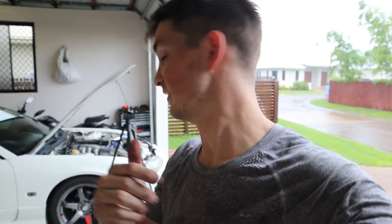When I took off that bleed valve, coolant kept coming out at a pretty fast rate with the screw all the way out - so it definitely bled the system but I was continually losing coolant. I let it pump out, refilled it, then put the screw back in and topped up the radiator. Now we're going to start the car, put the heater on, keep topping up the radiator with the cap off, and it should just burp out the rest of the air in the system.